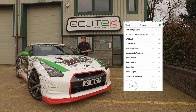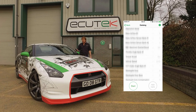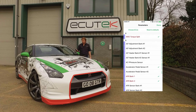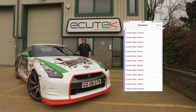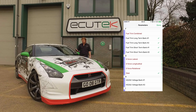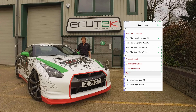The first feature is data logging. Data logging on the Nissan GTR is very fast — even faster than Pro ECU — with up to 70 Hz, 70 times a second. We've got standard data logging parameters, and in the settings in the top right-hand corner we also have RaceROM parameters, including things like custom maps, speed density, and g-sensors. You can enable and disable logging parameters as required.